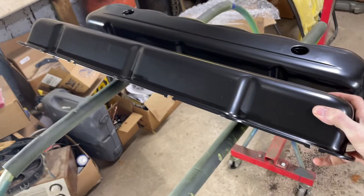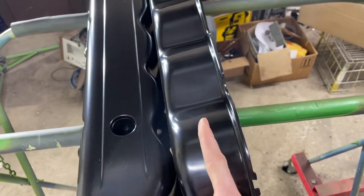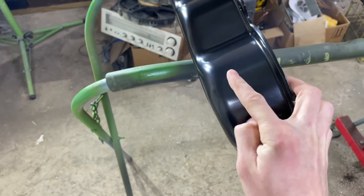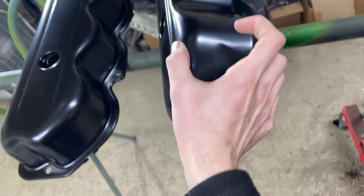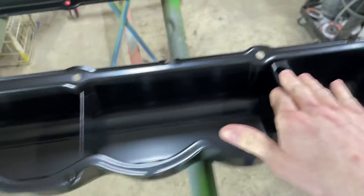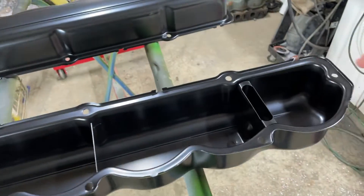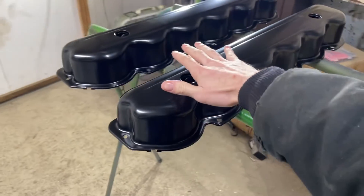The reason I have two of them here is because I'm going to cut them both in half. What I'm going to do is cut one of them somewhere in here, and then cut the other one somewhere up here. Then I'm going to take this tall bottom section and weld it to a top tall section, so I should gain about an inch to an inch and a half under the valve cover. I'm not sure if I'm going to have to do clearancing here — I don't know if there's rockers that sit anywhere near these baffles — but I can burn that bridge when I get to it. The plan is to cut these in half and weld them back together to make one taller valve cover.